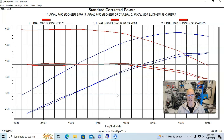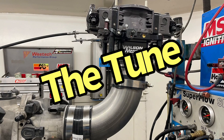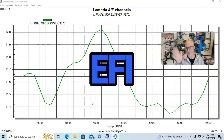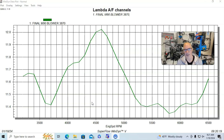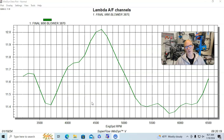Now let's take a look at some interesting information on the air/fuel, and I'll show you the limitations of trying to run a carburetor and fuel injection together. Let's take a look at the air/fuel curves when we were able to adjust things. This is the air/fuel curve that we ran on the pull with the EFI — it looks like a big fluctuation but this is about a half an air/fuel point change, so it's really not that much. We started out at 11.6, dropped down to 11.4 — essentially nothing. Started going a little bit lean at 4,500 up to 12.0, then back down to 11.4 or so and ended up at 11.6. It's moving around a little bit. When we made it perfectly flat, it didn't change the power output at all, so this air/fuel curve is obviously right.